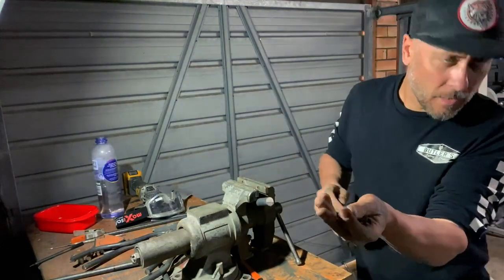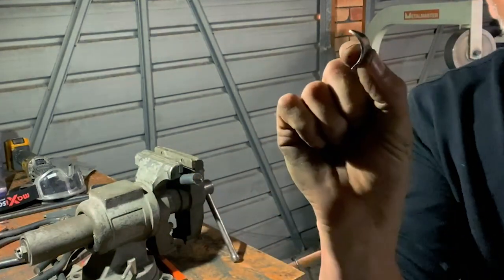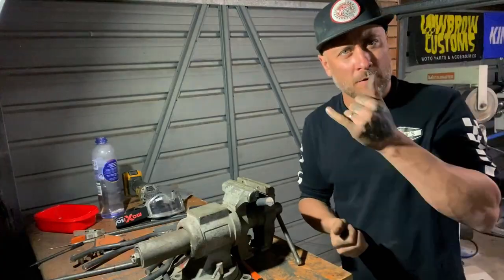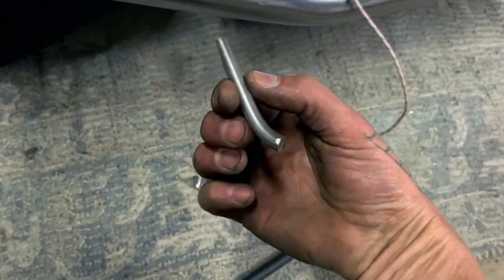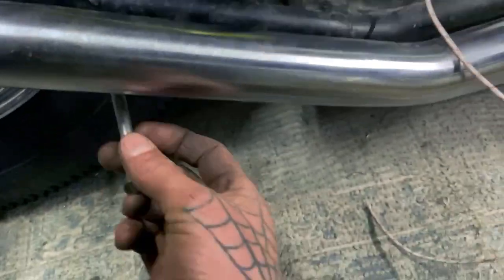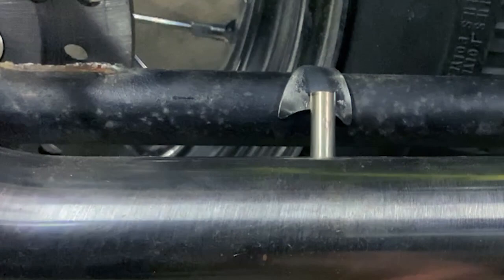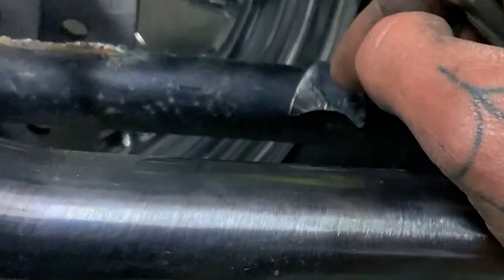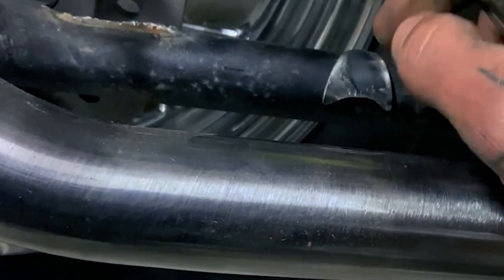We've got all our little bends done now. It's time to get welding. I've bent up these pieces of stainless and put a little cutout section in them. What that's going to do is sit up underneath the exhaust pipe, and then that cutout is going to rest on top of the arrowhead — go under there like that, sit on there like that, weld onto the exhaust and weld onto the arrowhead. Then we'll have a hole in the top of the arrowhead that'll drop down on top of a threaded stud and we'll put a dome nut on the top.